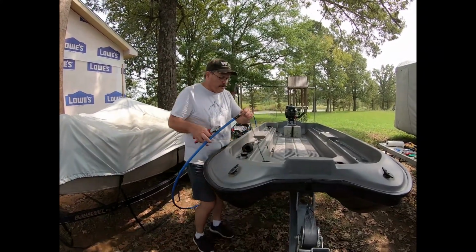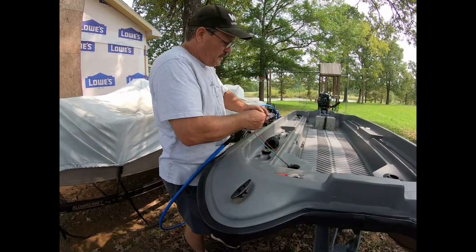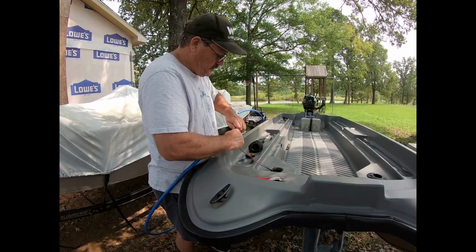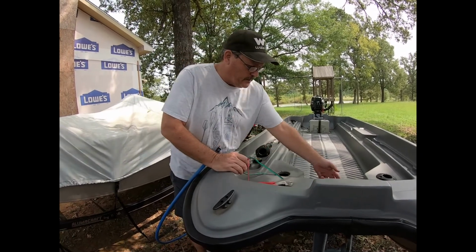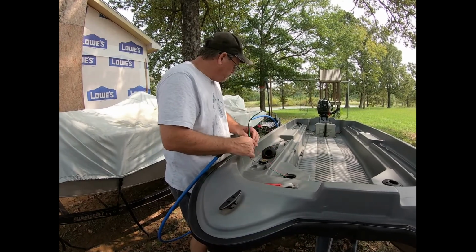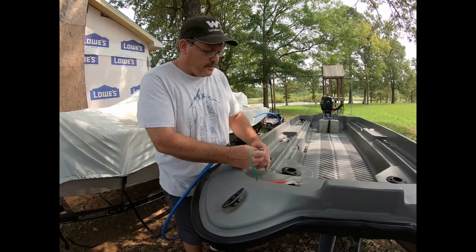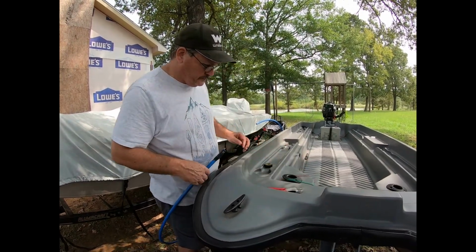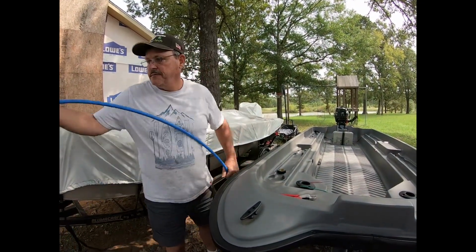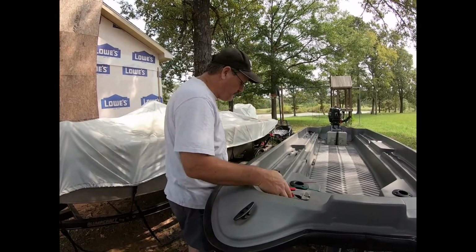So what I'm going to do is I'm not going to untape. Simply going to clip it off. I'm going to tie a knot so we don't lose it. And when we put our panel in, it'll be here, so we'll just literally have the wire right there. One thing you don't want to do is pull the cable tight, leave some slack in there. You never know maintenance in the future. And also, tight wire has a tendency to pull loose. Where it's laying flat, it will not pull on the connections as much.